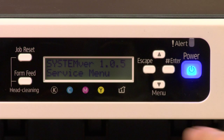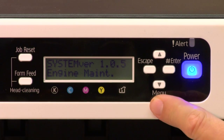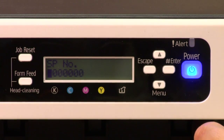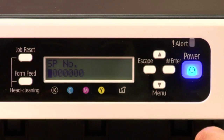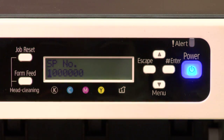Press the enter key. What you'll see is the service menu. Arrow down one time and you'll see 'Engine Maintenance.' Press the enter key, and now what you see is the SP number. This is where we enter a value, and the value we're going to enter is 3008003.